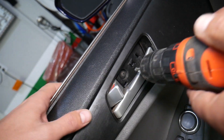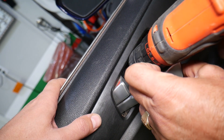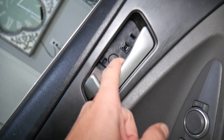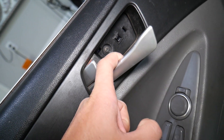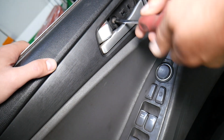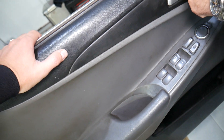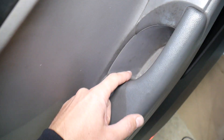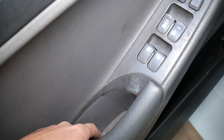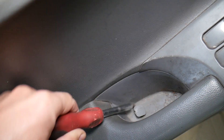We'll need to get a screwdriver to remove that screw — it's important to remove it, otherwise you will not be able to remove the door panel. It's pretty tight. Now for the 2010 to 2015 generation, it's a pretty simple design. There is one cap right here in the handle. Get a flathead screwdriver, pry it, and it comes up.